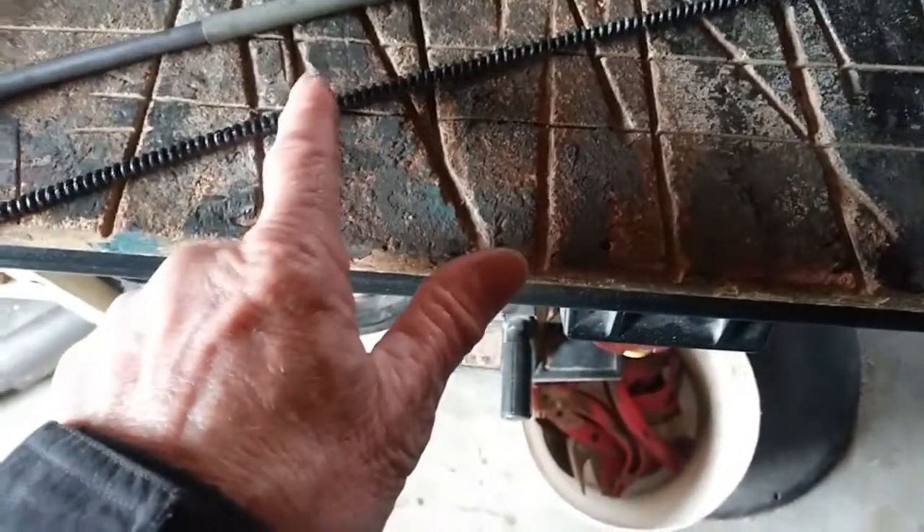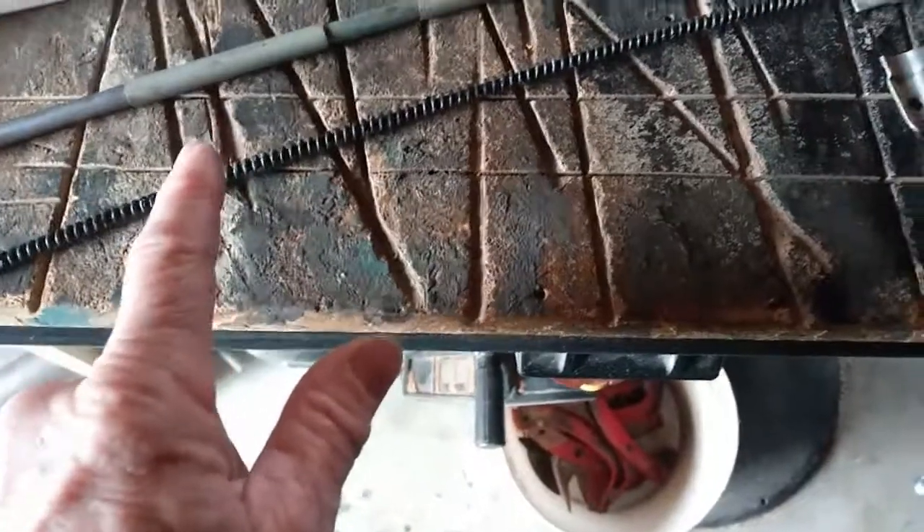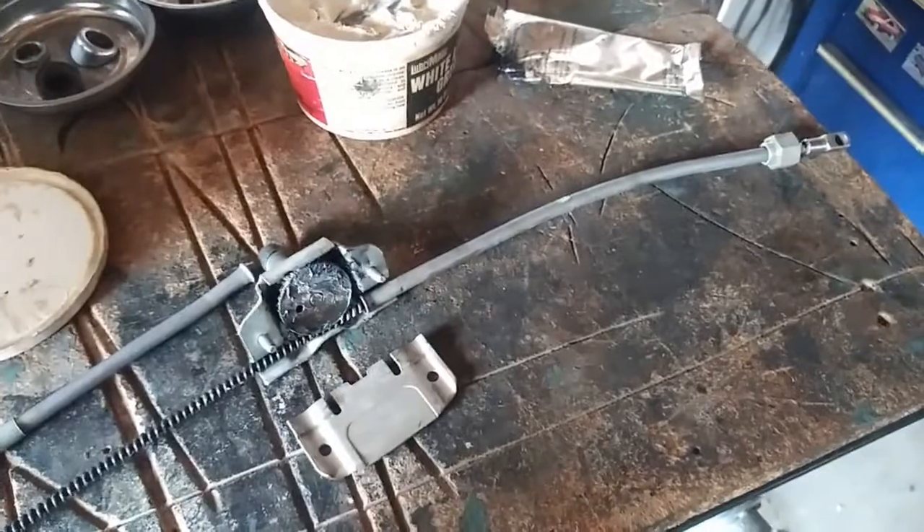You want to make sure that this cable — this winding — is lubricated inside of the guide tube, otherwise it's just going to bind. The motor isn't all that strong, although my motor now is from a '92 Mustang. Let's have a look at it right now.